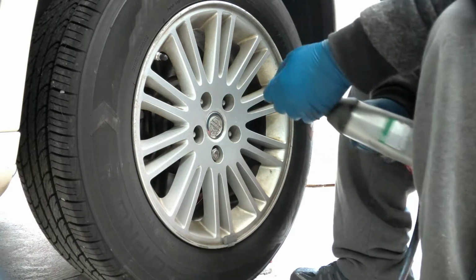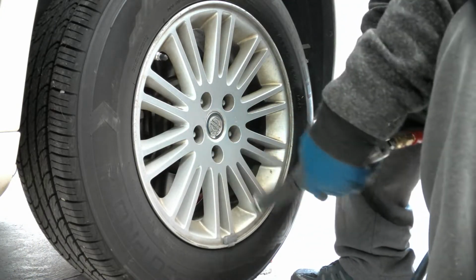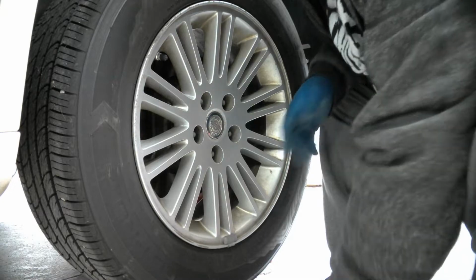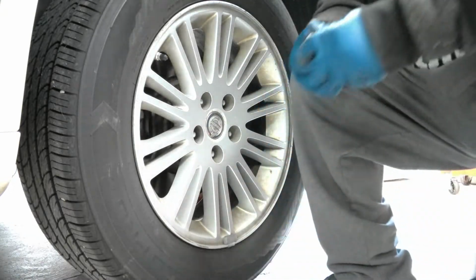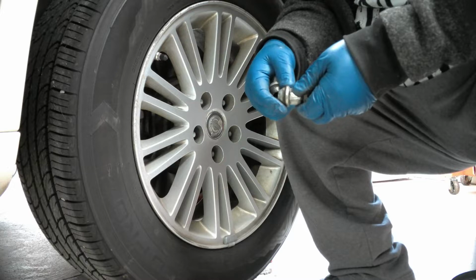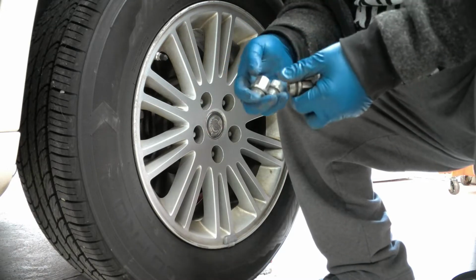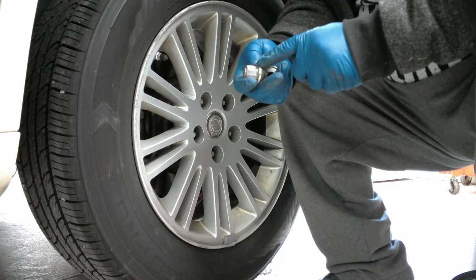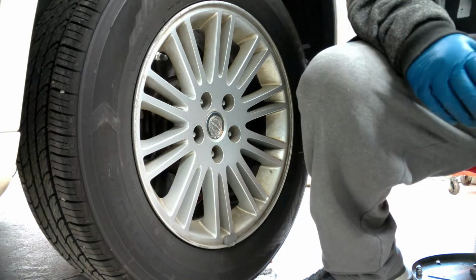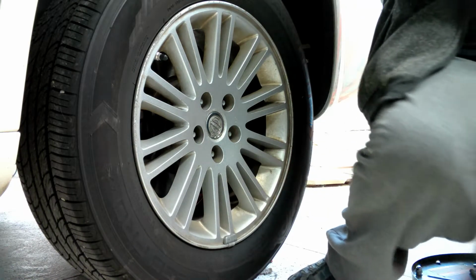You have to be real careful with these because they're metal with a cap on them. If you tear up the cap, they're harder than heck to get on and off. So you got to be careful of that. Most definitely. Replacements that they buy, they don't have this stainless cap wrapped around them. You can actually get them where they're one piece and they're stainless, or actually solid steel, but that's what I did on the front. I got tired of these caps tearing up. You look at them, they look real worn just from being on and off so many times with just changing tires. So it's definitely something to look at and pay attention to, because there's nothing worse than that.